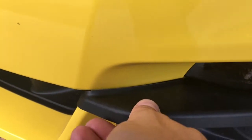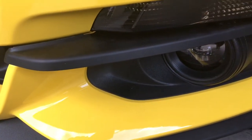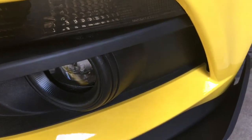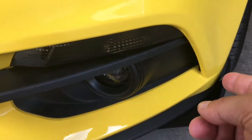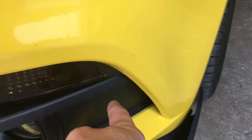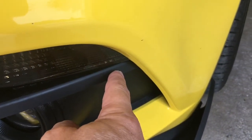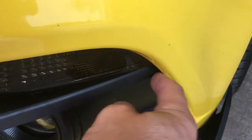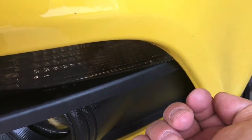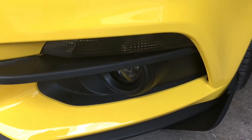The splitters do come with some tape. I may need to replace this one because it doesn't seem to fit right — I'm thinking maybe I could heat it up. This one you actually have to take the tire off and take the inner fender out, and there's a screw that holds the fog light assembly in place. You have to take that screw out so the fog light pulls away from the bumper, and then there's a little eyelet on the end of this piece that sneaks in between the fog light and the fender. When you put the screw back in, it goes through the fog light assembly and through the piece of the splitter.